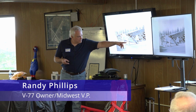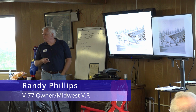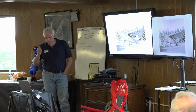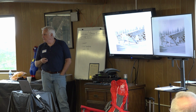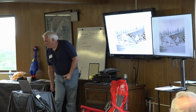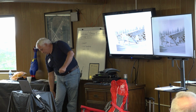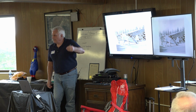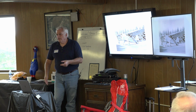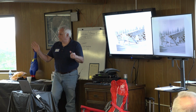Again, back to the tail, it's got the V-struts. Now the early, say 150 airplanes had tailwheel locks, but the British hated them so much, they had them removed. They even hated them so much they sent service bulletins out to the field to have them removed. And it was kind of a crappy design, because right on the floorboard, on the right-hand side of the pilot seat, so you lean over to reach it, and of course you'd lose sight of the runway. And then any side loading on the pin, which she used during a crosswind day, it would jam the pin enough, it was real difficult to release. So the British should just get rid of the thing.